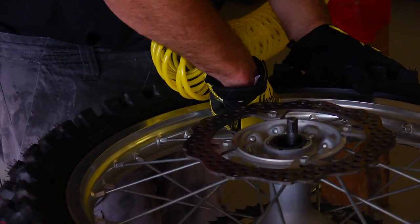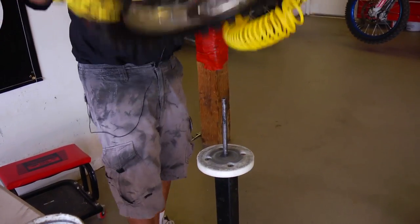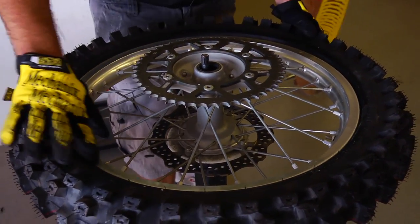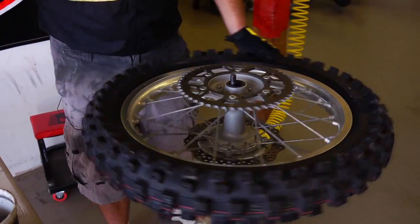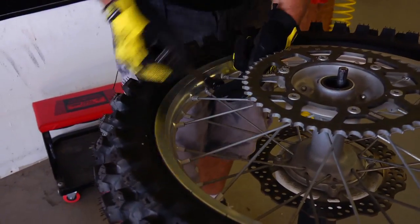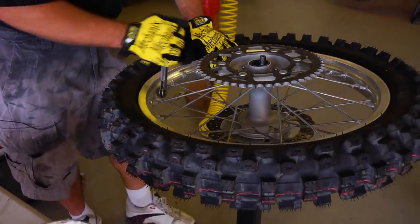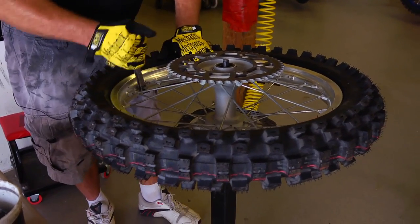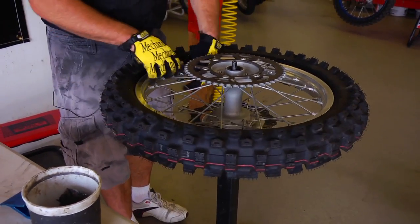At this point we're going to air the tire up. Having some good air pressure is nice because you fill it up quickly. We look all the way around — it's always a good idea to check all the way around to make sure you're all the way on the bead and it's seated. It's nice and warm today so the tire is popping right on; if it's cool out it's a lot harder. So we've got all our air in here. Now we're going to go to our rim lock and tighten it up. A nice ratcheting wrench is nice — I wouldn't use a ratchet or anything really long because you'll put too much leverage and can break the rim lock too easily, and risk bowing out your rim as well. You just want to get it nice and snug, about right there.